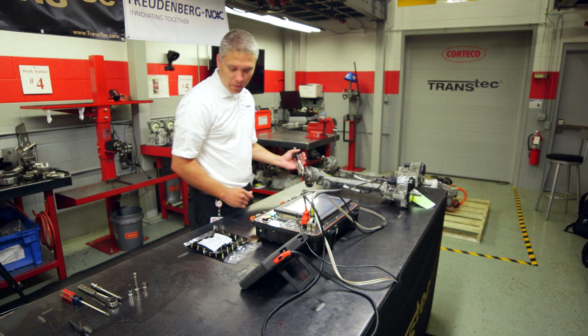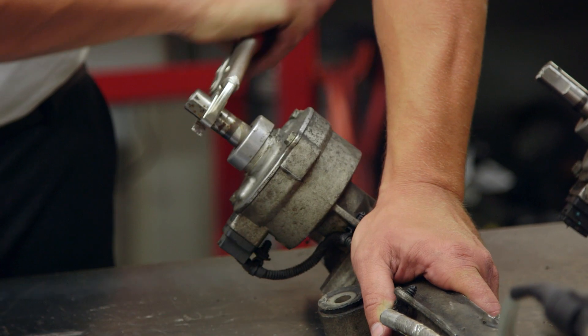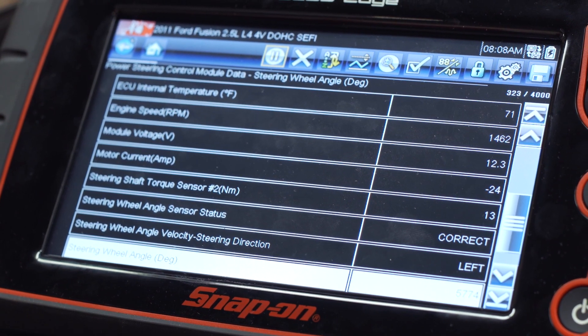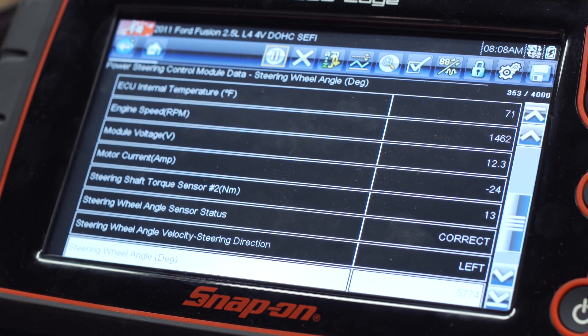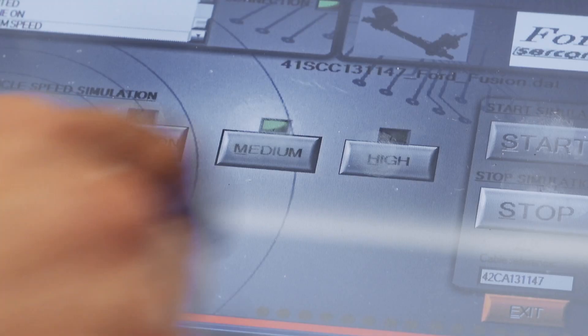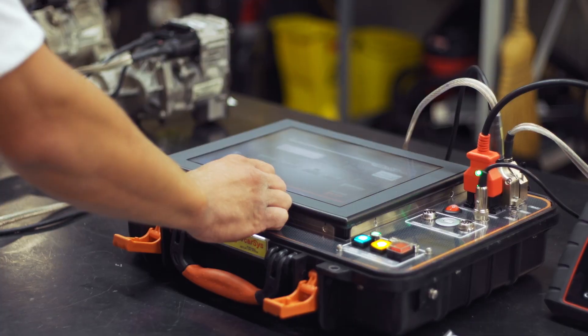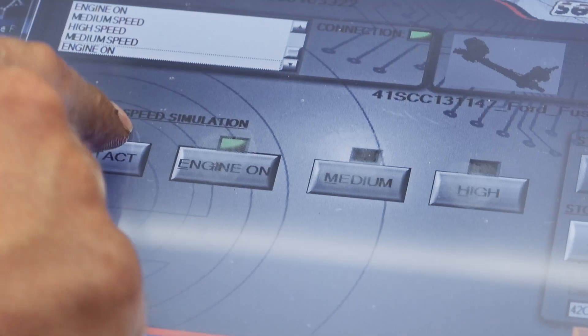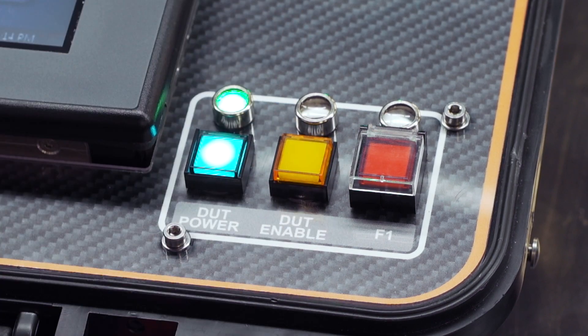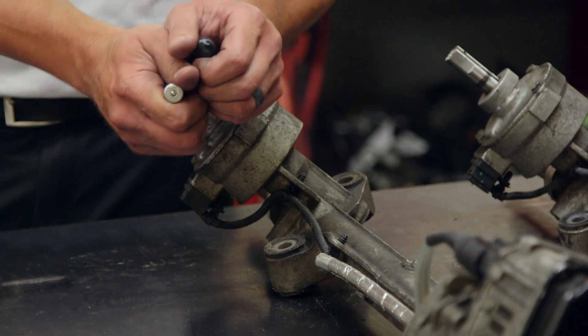Reviewing the parameters, the display shows that with the engine on, there are normal battery voltage values, acceptable engine RPMs when changing vehicle speeds, and acceptable ECU internal temperature. But despite changing vehicle speeds, the motor current remains at a constant negative 24 amps, and many of the torque sensor values are not responding. This confirms that the control module is not performing properly and requires replacement.